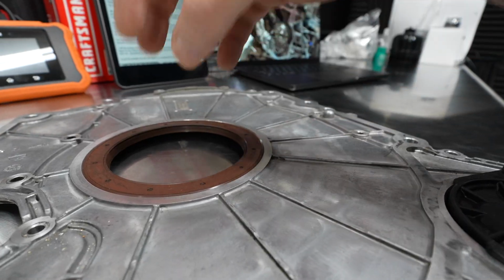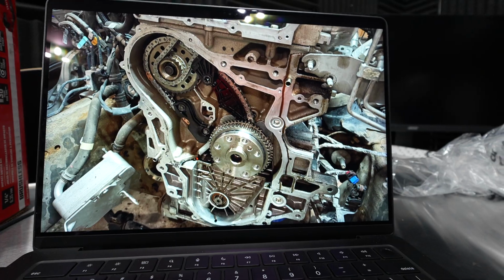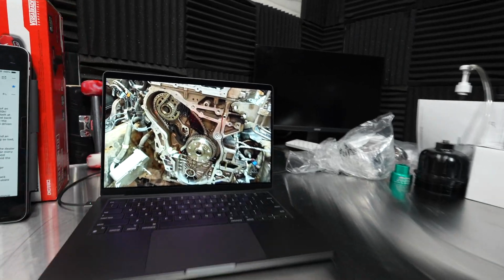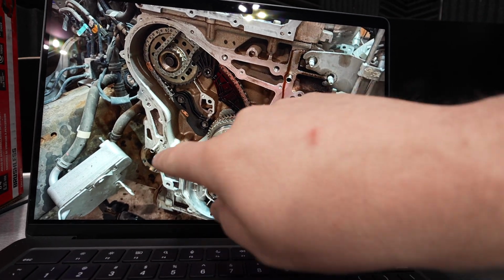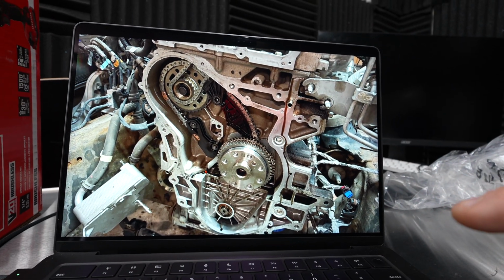At the dealer, we have a special tool that actually bolts on right here on the crank, and it will allow this to slip into place straight and perfectly flush with the crank. Now, that's a critical tool that needs to be used. So you do have dowel pins on there, and so it will help guide this into place properly.